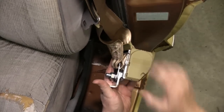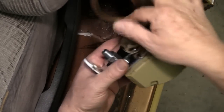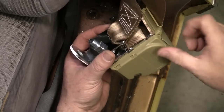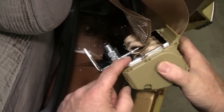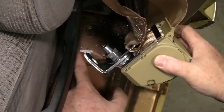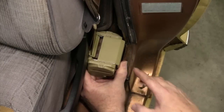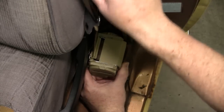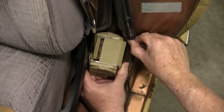What I've done here is I've gone in and mounted it up at the very top and assembled my seatbelt assembly the way I want it. I've got a spacer — one of the lock washers — holding this into position, making sure that the loop is not contacting the backside of the retractor so we're not rubbing when running it. I've got one of the L-pieces from the install kit. I want the longer end of the L on the actual retractor and the short end on the floor of the truck — that's what works best on the F-100. With the seat all the way back, you want to be sure you have enough room for this retractor assembly to pull freely inside the truck.